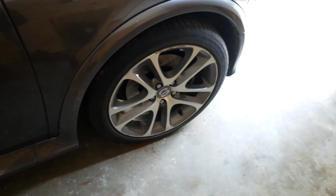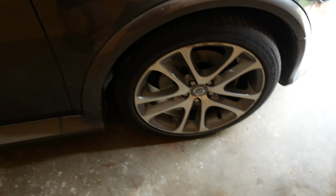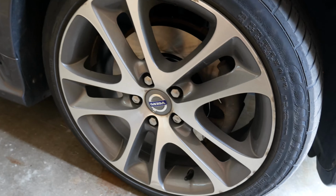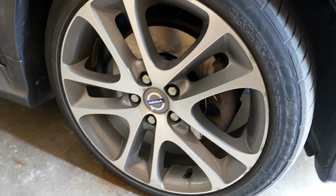When you come back, now this isn't a problem because we just did the fronts, but you wouldn't want to park and have your e-brake on, as you could warp things after their first initial heat cycle. So we're all done. Like I said, we're gonna just go do a quick break-in, but that's all we are doing for now.